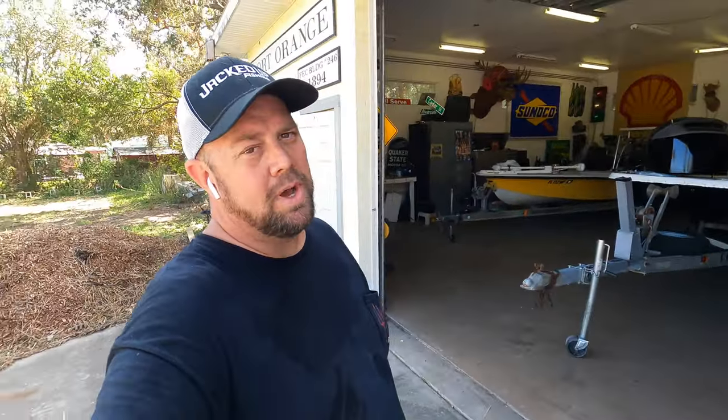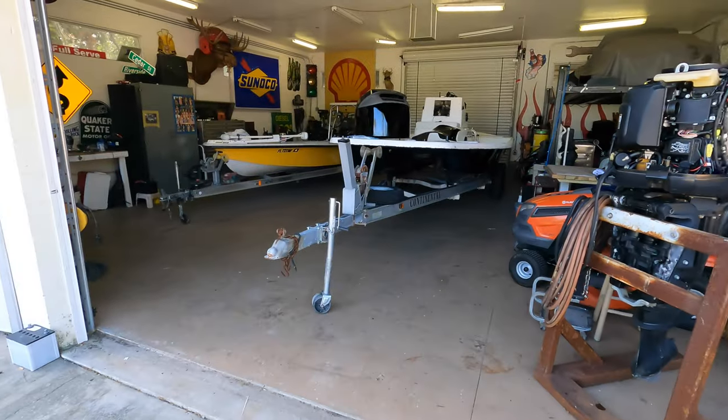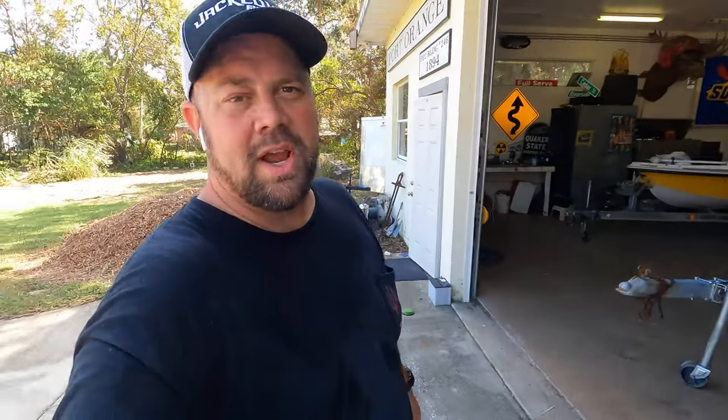So as you've seen, the cheap gun didn't work too well. I bought a nicer gun. It was like a $200 model, the Black Widow. It laid the paint down nice. I also fixed a few more things since I was doing it. Made it a little bit more straight. As you know, with black, it shows a little bit more, but that paint laid down beautiful this time. Took a little extra work sanding the texture down from the other gun that didn't shoot good, but all in all, worked out pretty good. Looks good. I won't have to buff it anymore. I can just wax it, keep it waxed just like a car.